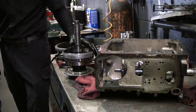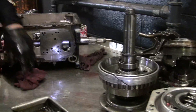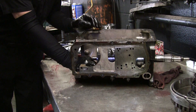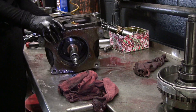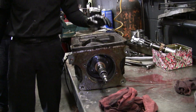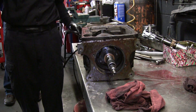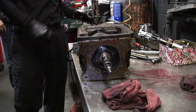Pretty slick. I wonder if marijuana was legal when they were designing this. Cocaine was legal. Just to think that somebody could sit down and design that sucker and put it into a small case and make it work — to me it's unbelievable. A planetary gear set is pretty easy: you've got your sun gear, your planet gears, and your ring gear. Depending on what carrier you lock in, it will give you a different ratio. One planetary gear set can give you three forward and one reverse depending on what you lock in.